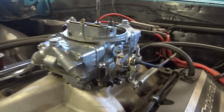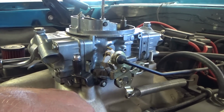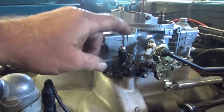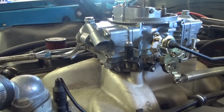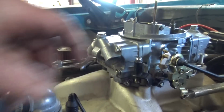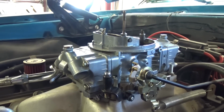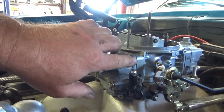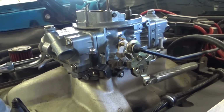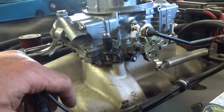Alright, so I got a brown cam. The brown cam and yellow cam, I only use the number 2 position. I need to get my feeler gauge and check my accelerator pump clearances, but it's looking pretty good. I did go ahead and put new gaskets in between my metering block and the carb body and my bowl, because I'm hoping this is the last time I have that front bowl off, and then we get to play with the back bowl.